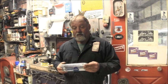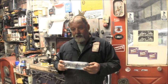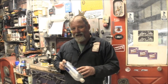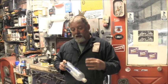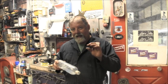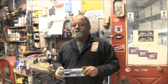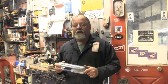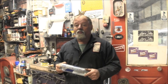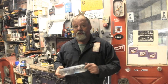But anyway, when the silver salmon start running really good, I wouldn't mind having one of these little four-stroker 9.9s that I could put on my Bay Runner skiff and put a regular prop on it. And then at idle, I'm thinking I could dial it down to troll at a real good speed. That's what I'm hoping. But we'll see how we make out in the next video with coming up with some kind of manual choke. That's what I hope to do, because that electrothermal unit they put on this model is not so good.